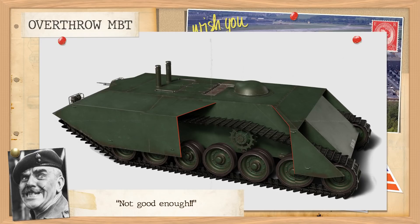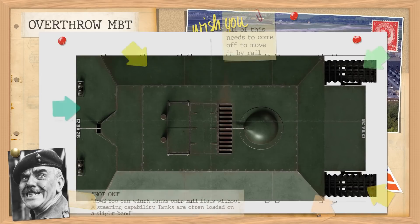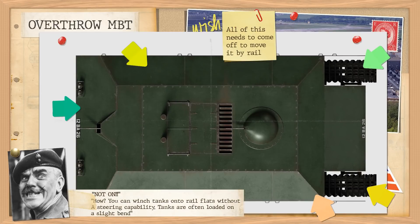This led to a few more problems. The first, going back to that two-crew part, was how to change the tracks. The side skirts weighed two and a half tonnes each, just the spaced plates. The second and bigger issue was how to load the thing onto a warflat or railway for moving. As first the side skirts needed to be removed, then the side packs at 15 tonnes each. But this still left it 13 foot wide and therefore couldn't fit a standard NATO railway gauge with its tracks on. They had to then build a tripod frame that would fit over the hull, attach to the engine and form a rig. This would lift all the armour off the sides, then the tracks must be taken off and the vehicle used an in-built winch to haul itself onto a flatbed. This obviously raised a few more eyebrows.